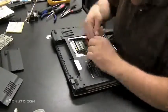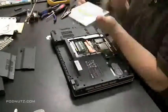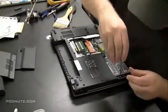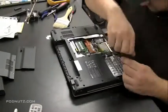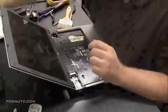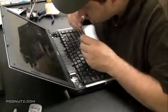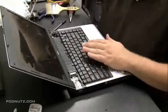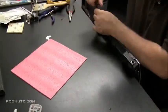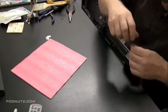Now that those wires are exposed, let's install the wireless card and attach the antenna. Make sure it's all nice and neat so when you put the cover on, nothing's pushing it out. Slap the CD drive in there, put the hard drive in, and attach the screws that keep it securely in. Hard drive cover — two screws holding that in — then the RAM cover. Make sure that's all flush. Dust the keyboard off with the paintbrush, make sure the ribbon cable from the keyboard goes in exactly the way it was, and attach the two screws at the top of the keyboard. Push the keyboard into the sides where there's a little pressure. Now the hinge cover. Put those screws back in; the remaining screws are holding on the hinge cover plate.